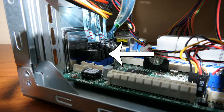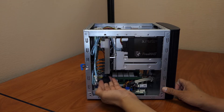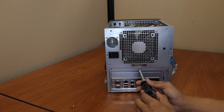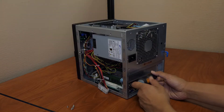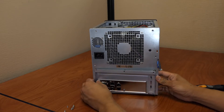Unplug the four SATA cables connected to the blue SATA connectors and any optional SATA cables connected to the white slots. Unplug each connector individually by pulling upwards on the black part of the connector. Remove the three motherboard tray back panel screws and remove the two inside edge screws. Gently lift and slide the motherboard tray outside of the chassis.